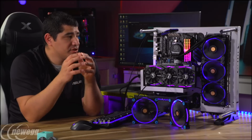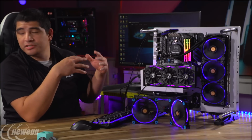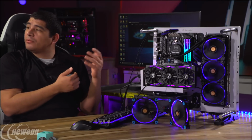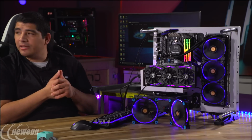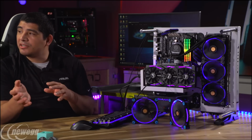So the big conversation that's happening online, just in general, is real-world gaming performance. What are your thoughts on that? So actually, the Ryzen architecture is really impressive in terms of the IPC gains that have been made. If you talk about gaming at the target resolutions that we would be building here, so we're building a system for 2560 by 1440 gaming, or 4K gaming, you've got a GPU that can legitimately offer a comparable level of performance to what you're going to have on Intel.